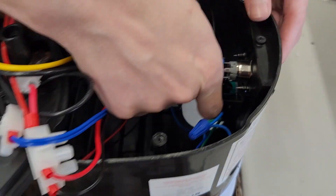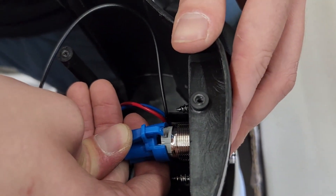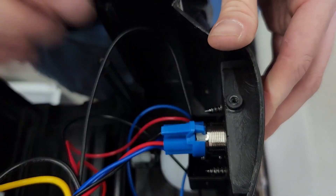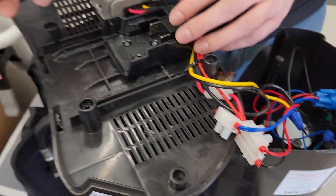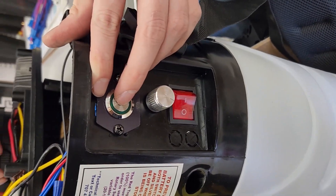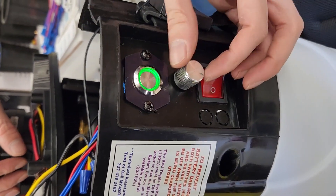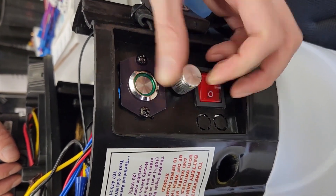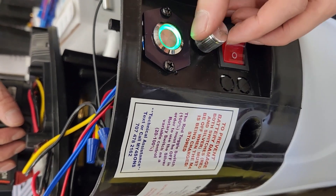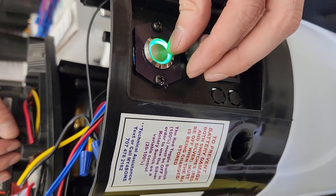Connect the black wire from the plate to the black wires of the M4 base. Reconnect the blue harness to the round switch by aligning the blue harness lock arm with the switch lock tab. Perform an electrical test before assembling the bottom plate to the base by installing the name brand battery into the battery lock plate and pressing the master switch on. The rim of the master switch will light up if successful. If the switch does not light up, make sure all wires are secure and the harness is lined up correctly and plugged in all the way.